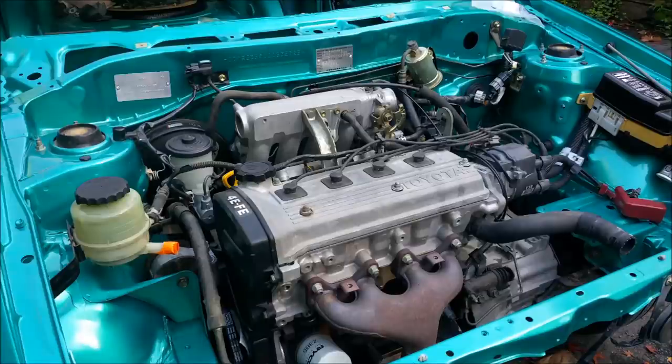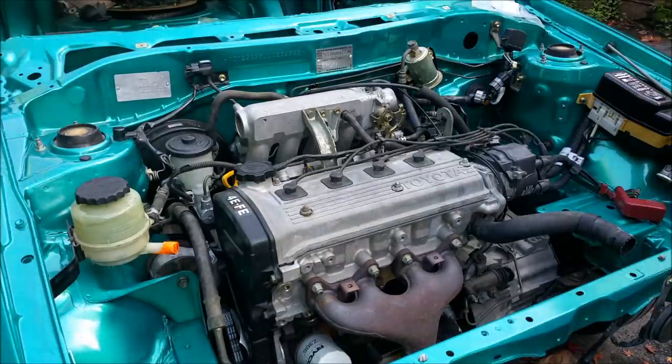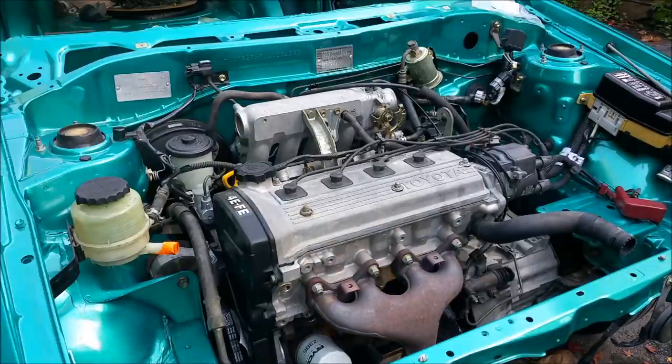Now, anything can happen in an engine. Things can go wrong, and in that case the computer will lodge and store codes. They're just fault codes, and they're read through this diagnostics box here. That's an old Toyota system, as I think I said before in the last video. Now it's all OBD2, so it's all standardized fittings, but the apparatus to read the codes uses different programs which can be installed that are relevant to each different model of vehicle.